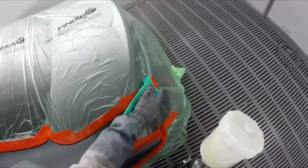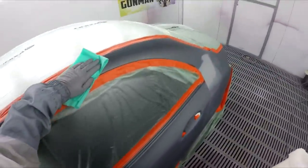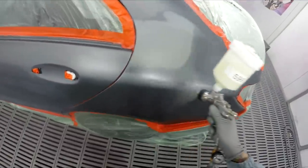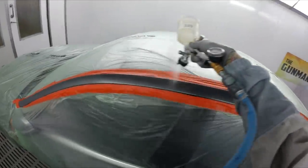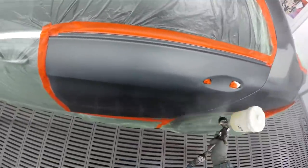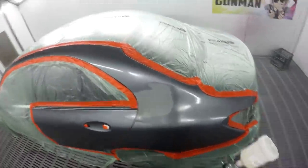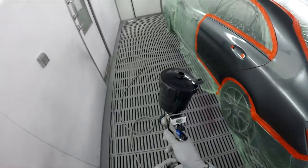It's clear - it dries just like base coat. It is a clear substance but it does have a very light yellow tint; when it's spread out thinly over a panel you won't notice any color difference. On a light silver sometimes you go too heavy on the edge, but all you can do is bring it up to the area you're working on - you don't actually have to spray right up to the very edge where the panel finishes. So I've got that down and I'm going to start putting the Vanco color down with the DV1.